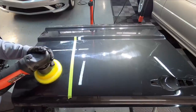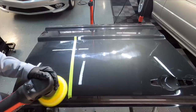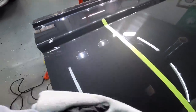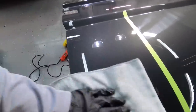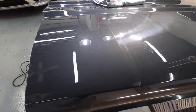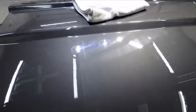This combination — let's start with the polisher. Again, another eight millimeter throw entry-level polisher, pretty much exactly like the first one, just different internal components. The pad itself is a foam pad — it's perforated, so it has airflow keeping the surface cool, which is important. And that's teamed up with the Hybrid Solutions polish and wax that already has protection in it. So with this combination, you're doing multiple steps at one time — turning around the paint and also laying down protection of carnauba polymers and SiO2. And this, again, you could do by yourself, that easy.